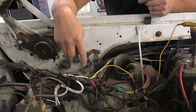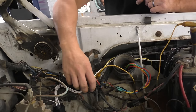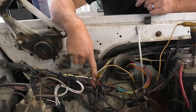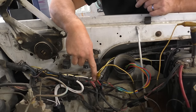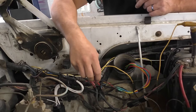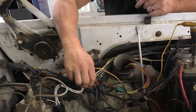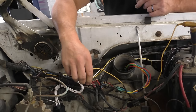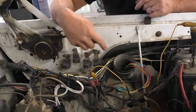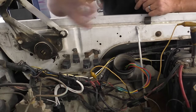Okay. So folks, what probably happened here, the original problem is we've lost power to one of these red wires from a fusible link. So that's why this relay doesn't work. The other reason the truck doesn't run is because the fuel pump doesn't work. So when we jump power directly to the fuel pump, it doesn't work. But when we jump power to the red wire, which goes to the single board engine controller and the auto shutdown relay, that all works.